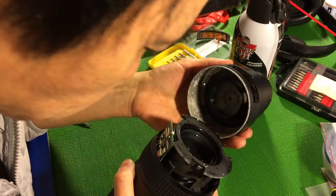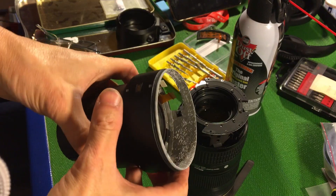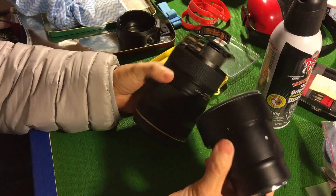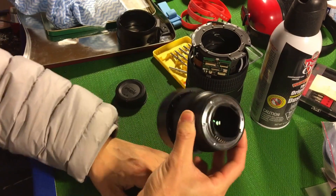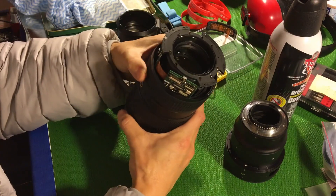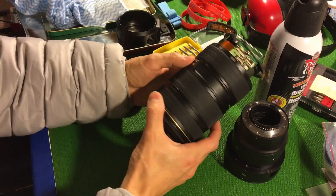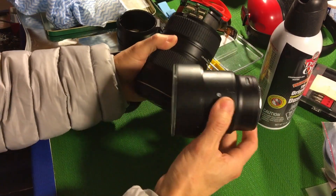Wow — it's all rust! Look at here, all the salt corrosion. Now this lens is broken into two parts. I think this section has the aperture. I can feel the image stabilizer is in this portion, and for sure here is the manual focus, zoom control, and autofocus. I need to make a decision about which part is wrong — my feeling is this part, so let's continue to break down the image stabilizer section.